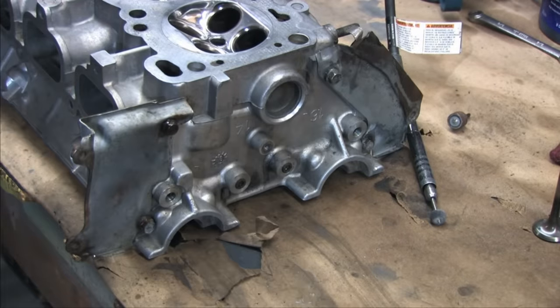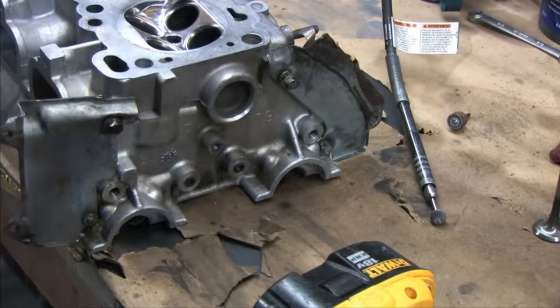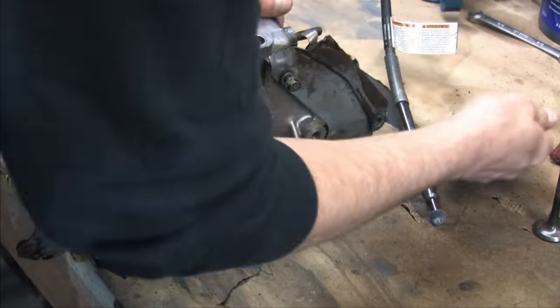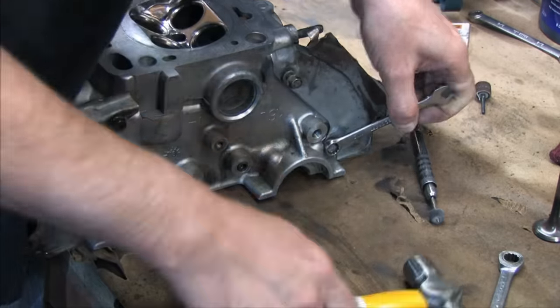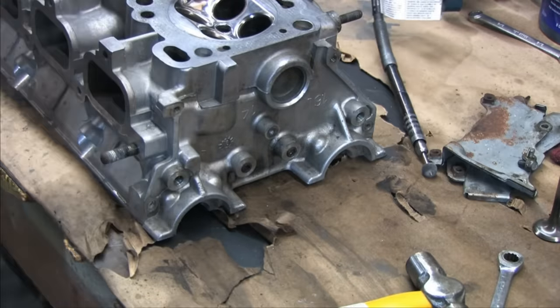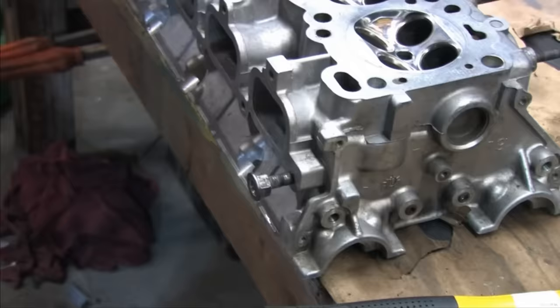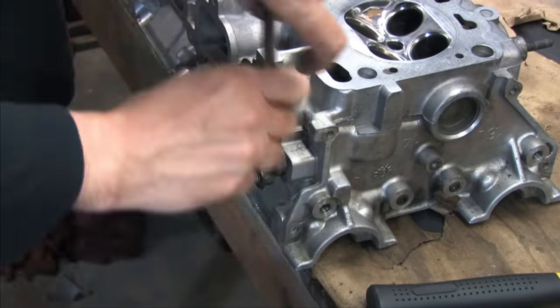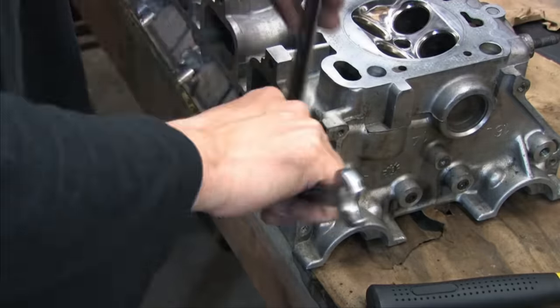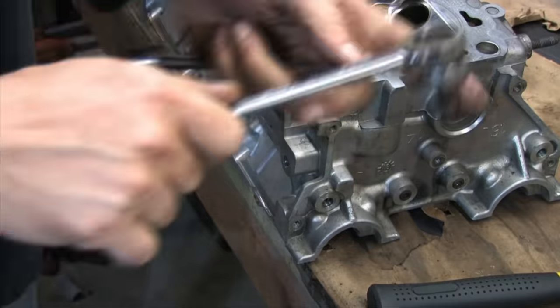I don't think Mitsubishi cared much about the job they did casting these heads for the Hyundai Elantra. I'm pretty sure Hyundai was thrilled with it because it helped them get their automobile brand off the ground back when they couldn't even produce their own engines. But I'm not particularly happy with it. Not at all, not for how I'm using it. The whole time I spent polishing the combustion chambers left me staring at some pretty unforgivable casting work that's robbing this car of its potential. I took my time on the block to measure and correct its flaws, and the head deserves no less attention.